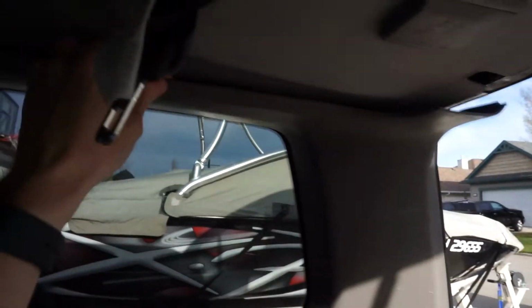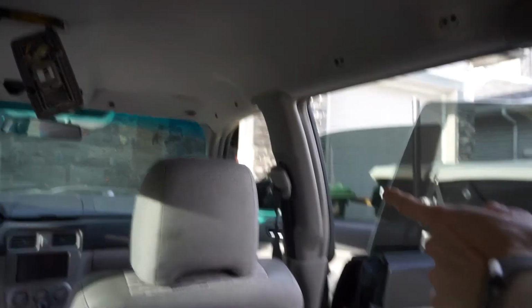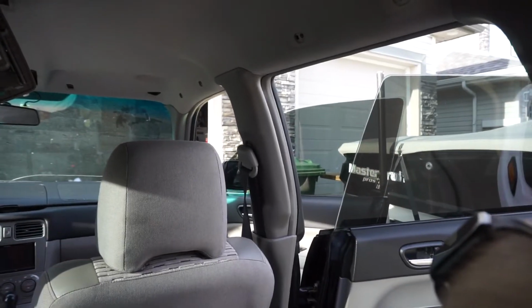Now it's the pillars. So I think I should be able to just pull them out for now, and then we should be able to start moving the headliner at least. So it looks like we can probably pull it off because these just pop out with clips again. You know, Subaru and most cars just use the plastic trim on clips. So what I'm going to try to do is remove the front ones too, and then see if we get any movement.